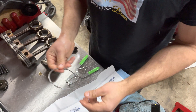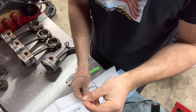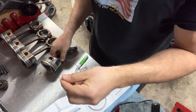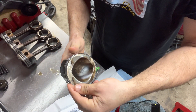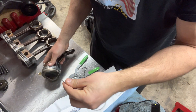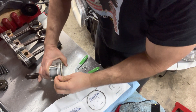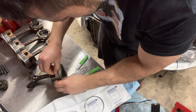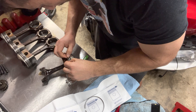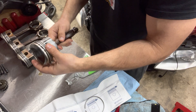First thing I'm going to do is pull out the oil control ring. It's got the ring and like a spring on the inside of the ring. What I'll do is pull the spring out just a hair - enough that I can slide it over my piston and seat it into the groove it's supposed to go in. Then once it's in that bottom groove, I tighten up that gap we created by sliding the spring out - just use my fingers to slide it back. Naturally the spring will have a little bit of play and that's okay because it's going to expand out and hug the cylinder wall.